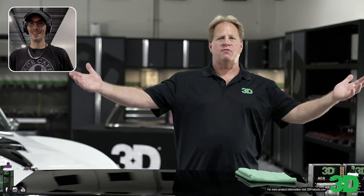And when I was younger, before base coat, clear coat technology was introduced, the gentleman brought me a white Jeep. Body shop had sanded down the hood and couldn't get their sanding marks out, so he brought it to me to see if I could. And I'm thinking, sure, I'm Mike Phillips, I can do this. I start buffing. Yeah, no, sanding marks weren't coming out, because single stage white paint, titanium dioxide, is very hard.